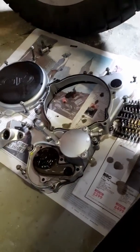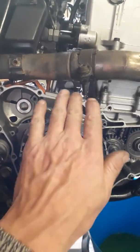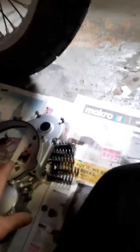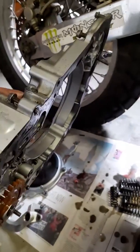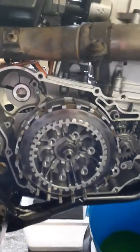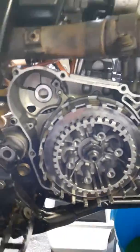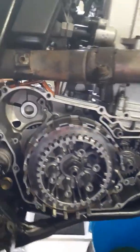Good morning. I removed the clutch side casing because this bike is leaking from the original gasket. It's actually the first time I've opened the engine after six months after rebuild. The thing is, if you tend to over-tighten these things, these threads tend to strip. The bike's over 10 years old so I don't really want to torque that down any further.